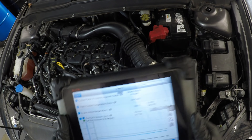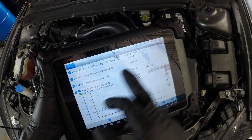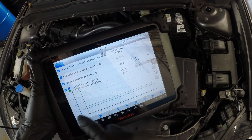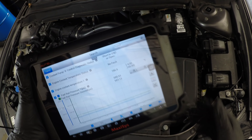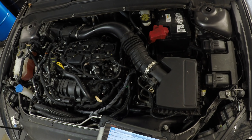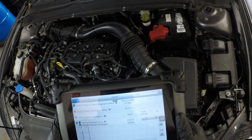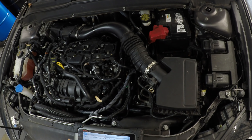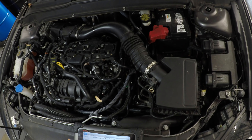I've got a couple of PIDs here - coolant pump diagnostic status, coolant temperature no fault, actual temperature 186 degrees, and fuel rail pressure actual versus desired right next to each other. I want to see if I get any dropouts. This is my fuel rail pressure sensor right here. I've never encountered this particular situation on this particular engine so I want to play it safe. My coolant level is actually not that bad so I'm not really worried there.